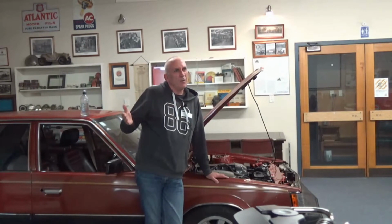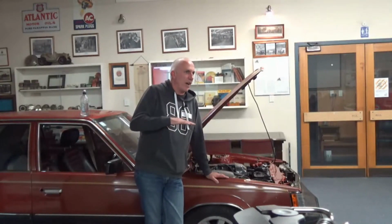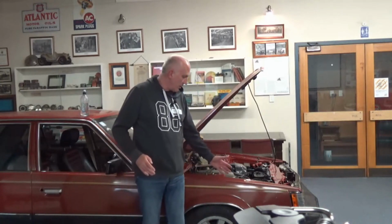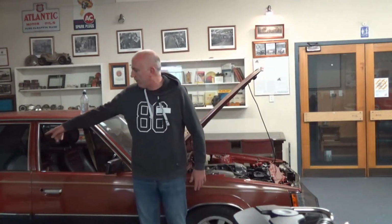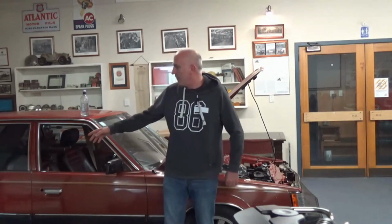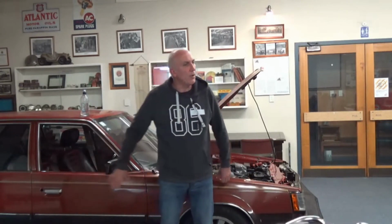What makes a car cool, and I think number one is stance, and most cars benefit from being a little bit lower, a little bit of rake. The right tyre to arch fitment, and that's in two dimensions as well. It's not just the vertical height, but also where the wheels sit in the guards. And if anything, the rears were flared badly by somebody, which I can't understand why, because I can't imagine how, if we got tyres on it, it would have needed it. So unfortunately, the rear lips are probably the best part of an inch further out than they should be, and as a result, the rear wheels and tyres sit in a little bit more than I'd like.